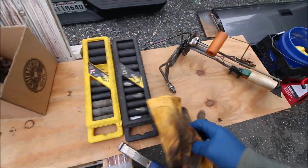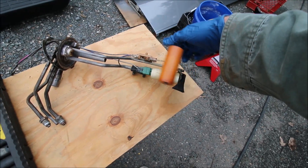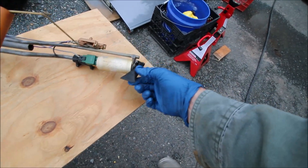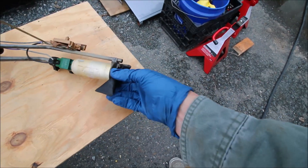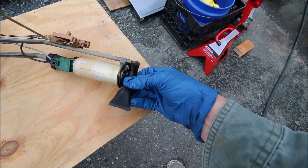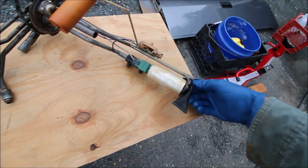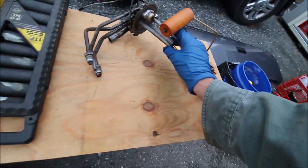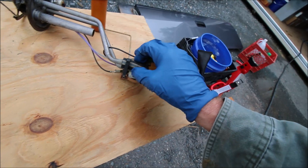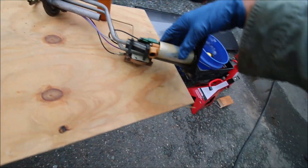Here's what everything looks like outside the tank. This is your float for the sending unit to tell you how much fuel you have. This is the pump, and this is the initial filter screen to keep particulates from getting into your pump. This one being 30 years old is trashed — it's junk. I'll replace the filter, the pump, and these hoses, which can give problems. This one is coming apart — you can see the black specks hitting the plywood — so that's getting replaced too.